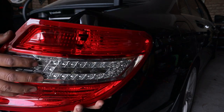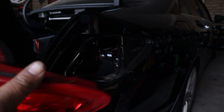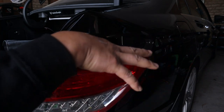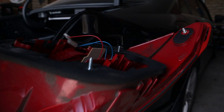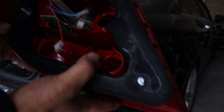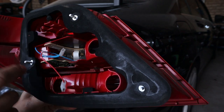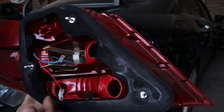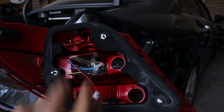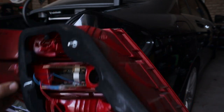That's how you remove your rear tail light assembly. As you can see, this bolt goes in sideways so you want to release this bolt first before you pull it straight out. If you have LED turn signals, be careful — your turn signals run off an LED light, not a halogen bulb, so you need to disconnect those cables before you remove your backing plate completely.